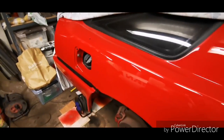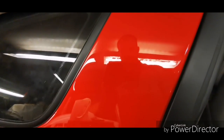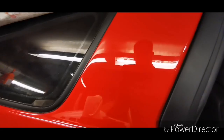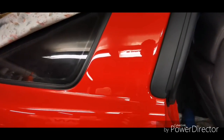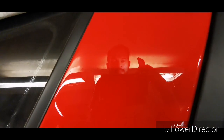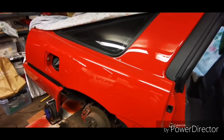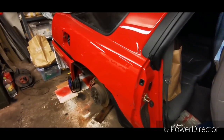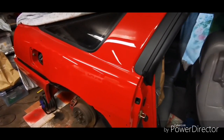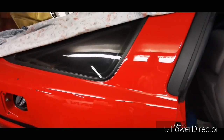This is what it looks like now — the reflection is quite good. If I put a flashlight on my face you can see it quite clearly. I've done all the painting myself. Started out with a solid color — you can guess which color this is. On top of that I added several layers of clear coat which are wet sanded, and finally polished.